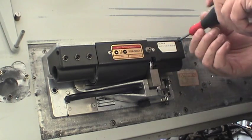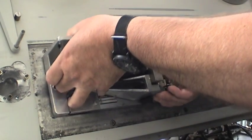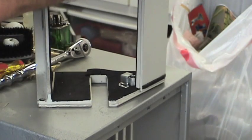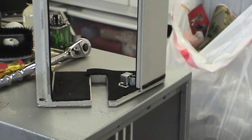Let's take the video heads off — there are three screws, and that's the last captive screw that I've removed. I take the video head cover and apply a foam on the inside to make it look nice and reduce some of the noise. Here's what that foam looks like — it's very tight, kind of a craft-type foam that's easy to work with.